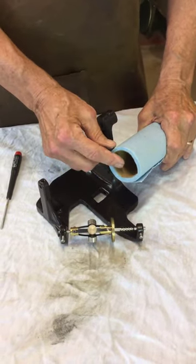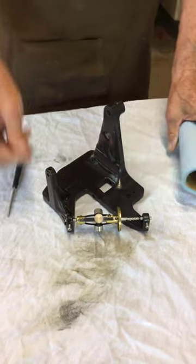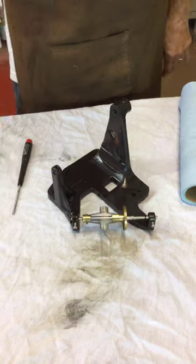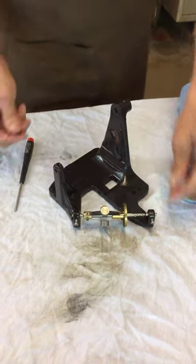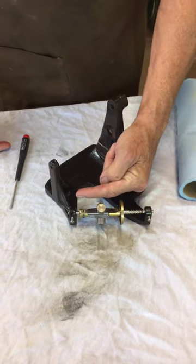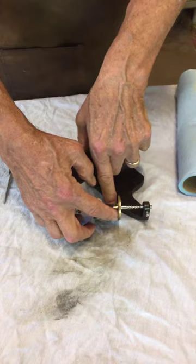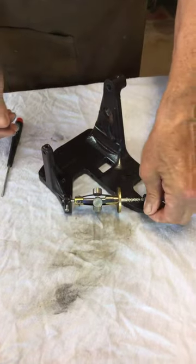Almost all phonographs work this way — it'll be reversed one way or the other. So what you do, as you see, that won't spin — that stops. Because when the machine's running, the governor pushes back this way, because the felts were right here to adjust the speed.